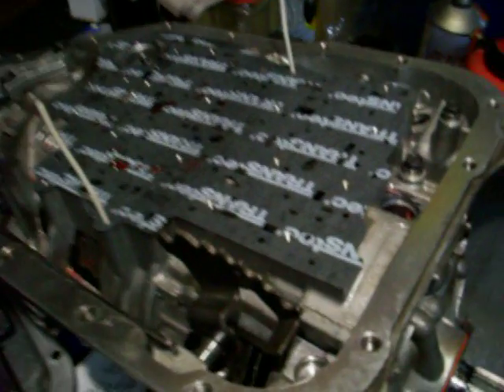So I want to start with our separator gaskets, or valve body gaskets. There are marks so you can't mix them up — this one over here has a C, which stands for case. So this one's going to fit up against the case. The book says you should use a couple of dowels to help align these paper gaskets, but unfortunately we don't have the proper sized dowels, so we have to make do with these little things I made with a couple of pieces of old wiring I had kicking around, to help hold things relatively in a straight line. We're going to put the separator plate on now, just making sure that everything is really well aligned, because you don't want to have gaskets pinching and things getting ruined, although you can jiggle things around once you start getting the valve body on.